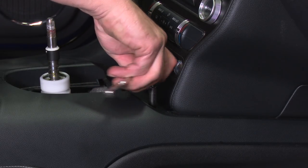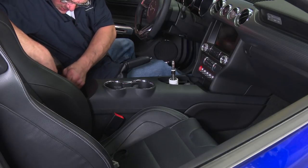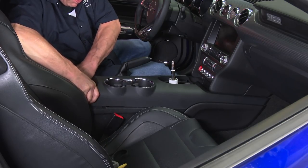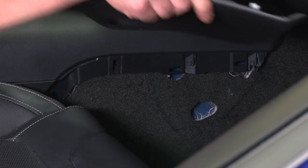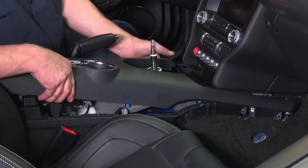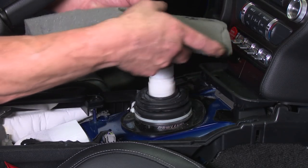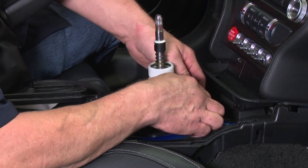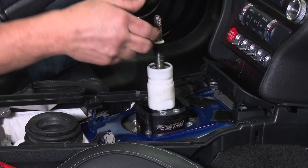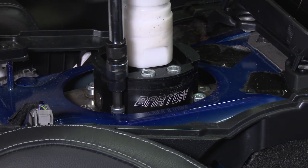We're going to remove the two bolts in the front and take off the top plate from the console. To remove the top piece, you start prying in the back — it's held on by clips. Remove the two side panels, remove the two 7mm screws, then release the clips and pull up on the top plate. Then separate the rubber seal from the floor. This Barton-specific stuff — the Barton is modular, so it allows you to remove the top piece, which makes it easier to get the transmission out.